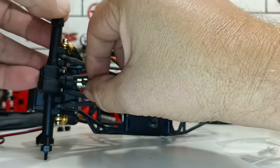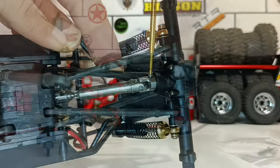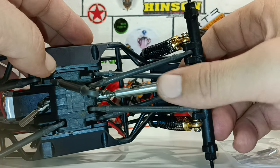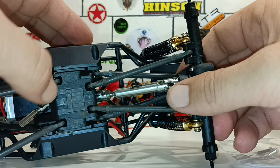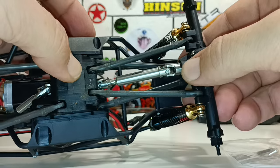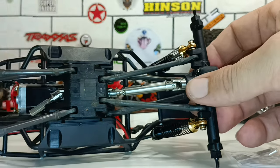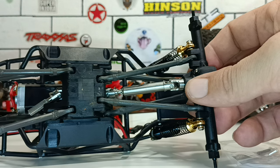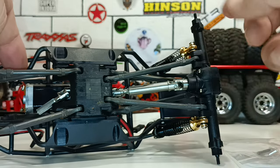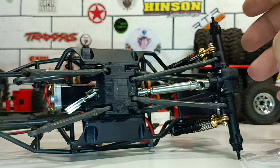All you gotta do is turn your axle a bit until you find the spot you need. Okay. And this was still the first generation of stainless steel driveshafts. People said you couldn't get them in phase. Well, I beg to differ because they both match up 100% exactly the same as the hardened black ones. Okay, now I know the front one I don't have as much luck. It's about 2 millimeters off from each other, but I don't see that being a big problem on a slow crawler like this, guys. Now, let's get the front axle on.